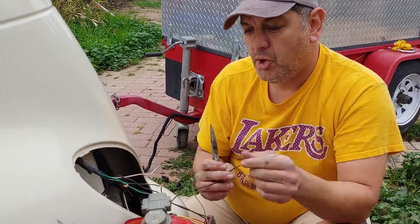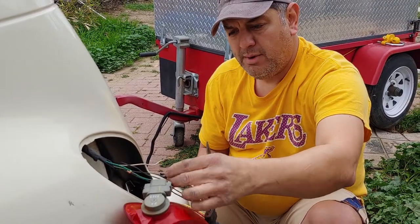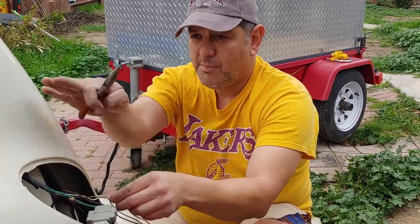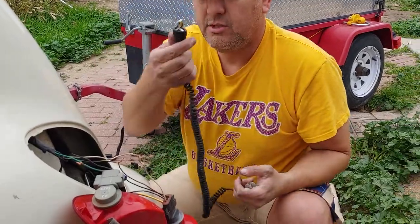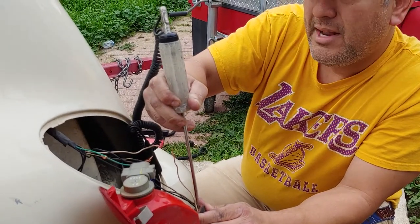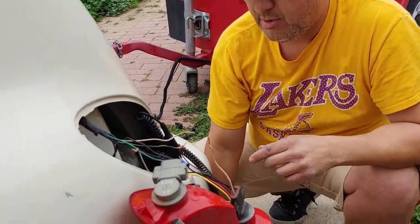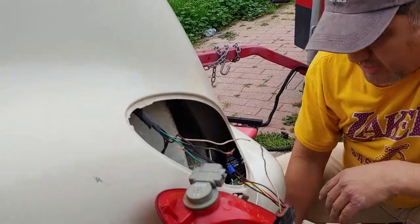So now I know that this is my stoplight, this is my tail light, and this is my regular running light because we just tapped them and identified them. I would do one by one — if you're scared of doing all of this, just do one by one. Find the one that, okay, step on the brake and then find it. How did I find it? I had this connected to the ground. I poked it in here, it lit up, and then this one was blinking. Pretty easy to identify. If you have any questions, go ahead and shoot me a comment.